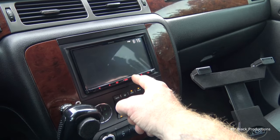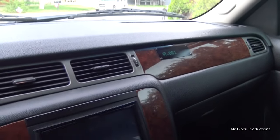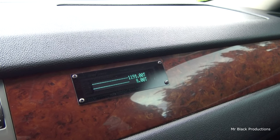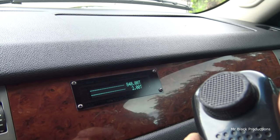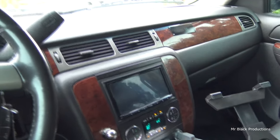Okay, so let's go over here. Let's turn this off. That brings on the 20 pill. So it's about 4 watts of reflect with 1,000 going out. Hello, 1-2. I just have the microphone literally chilling. Hello, 1-2. So I have one whole watt of reflect with about 800 to 1,000 watts going out, which isn't bad.